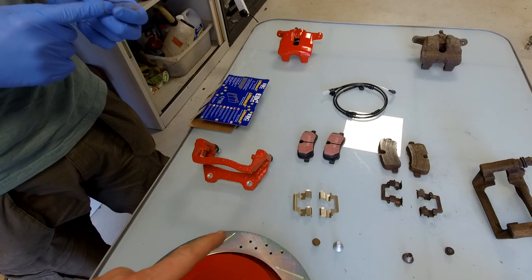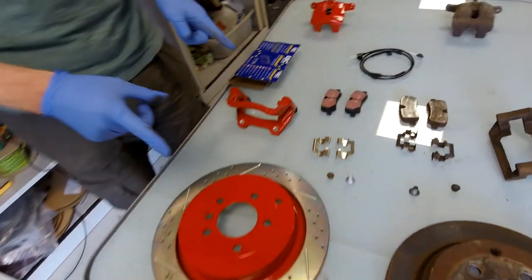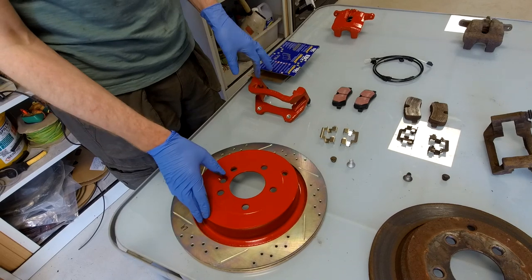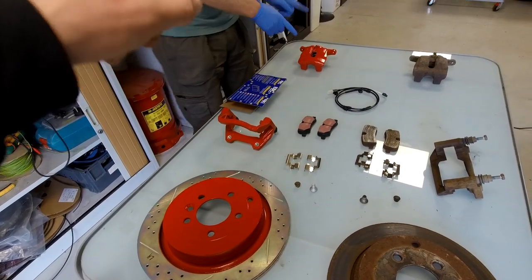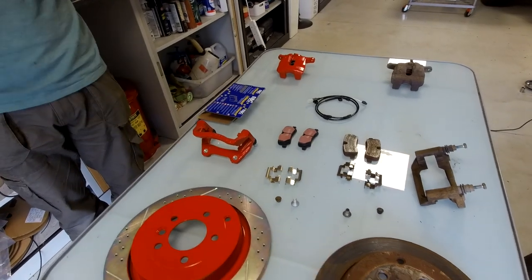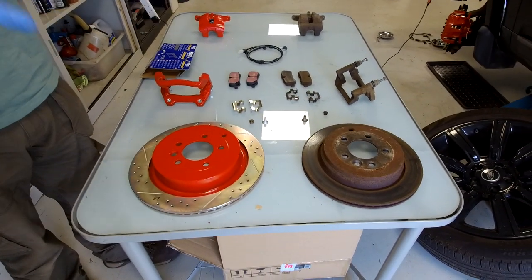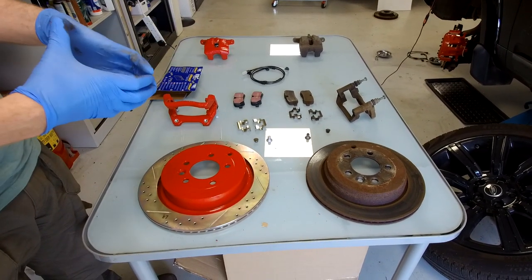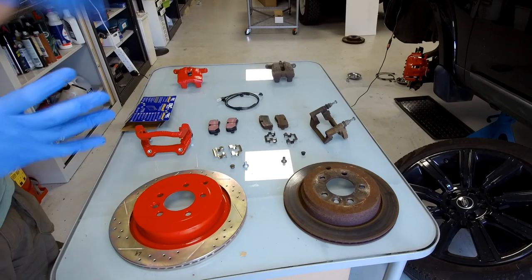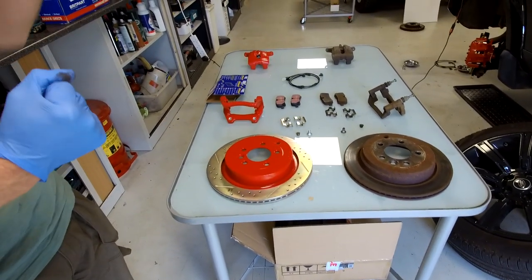You're probably doing this because your brake pads are worn so you may as well upgrade at the same time rather than just replacing, which means your sensor will be worn out anyway. The bits we supply won't be painted, but if we get a lot of requests we may get a batch painted. You don't need to change your caliper - keep your hoses bolted up. You shouldn't need to bleed your brakes for this upgrade. For the rear brake shoes and brake adjustment it's all the same as the Discovery 4 - we'll link that video - but this video focuses on the diesel to petrol upgrade on the rear brakes.